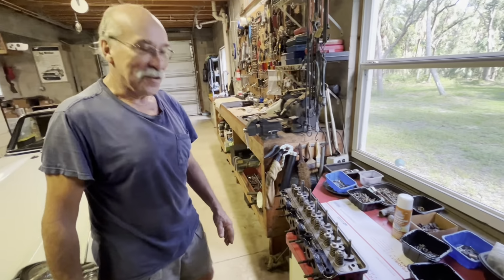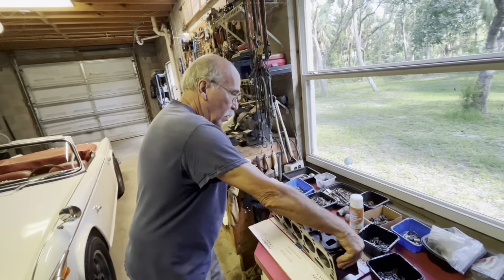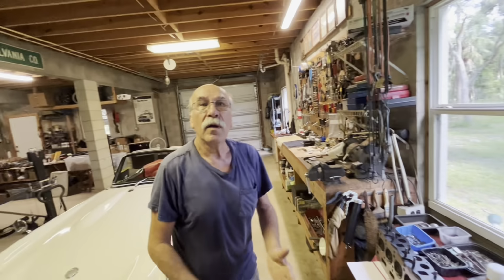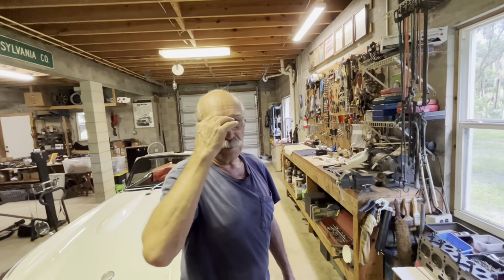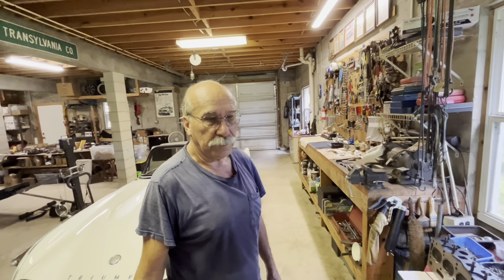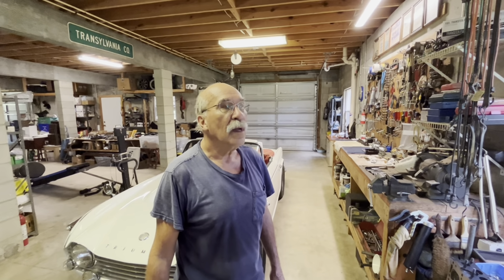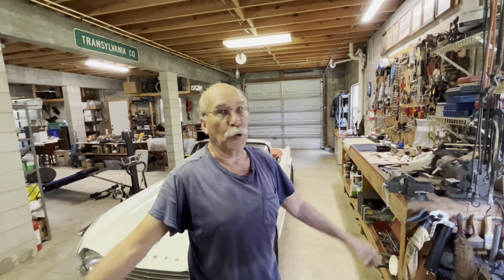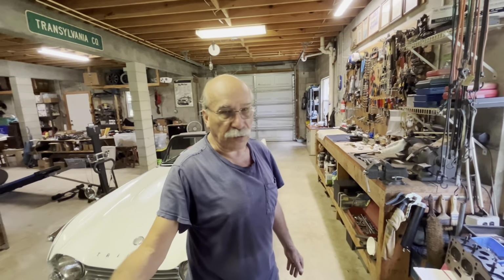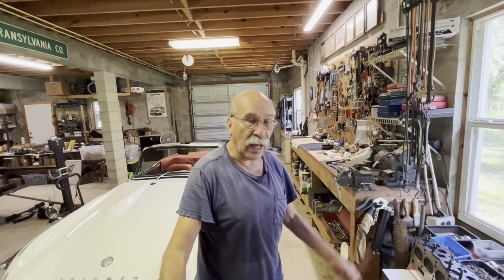So, Fred, before we talk about the bad news, we discovered that this was the overheating issue. Turns out that the ports were clogged. Not all of them were clogged, but most of them were. And in the next video, we'll talk about why we were getting that crappy gunk coming out of the overflow tank. Basically we're dealing with an engine that sat with water in it for like 30 years or whatever. And of course the corrosion within it, some of it broke loose when we were using flushes, and we got a lot of it out.